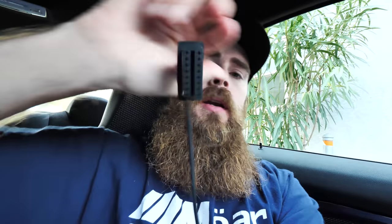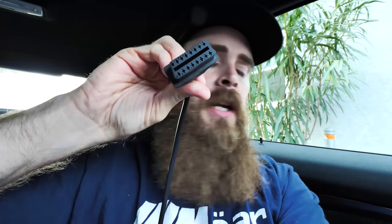Now if you have an older vehicle like an E36 or E30, it's not going to work on all of them because you don't have an OBD2 ECU. But if you have an E36, you may have one of these diagnostic ports right here — this goes in the engine compartment. It gives you an OBD2 connection, so you would just hook up that little adapter to this and you'd be ready to go for some options.